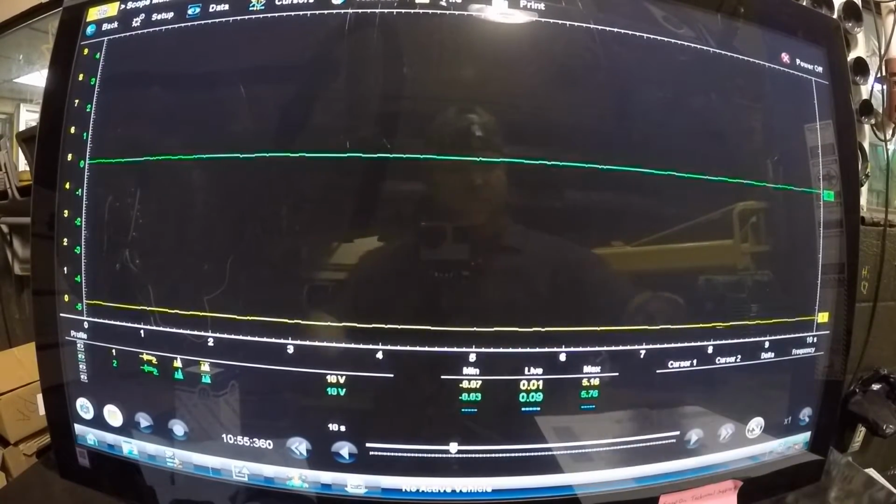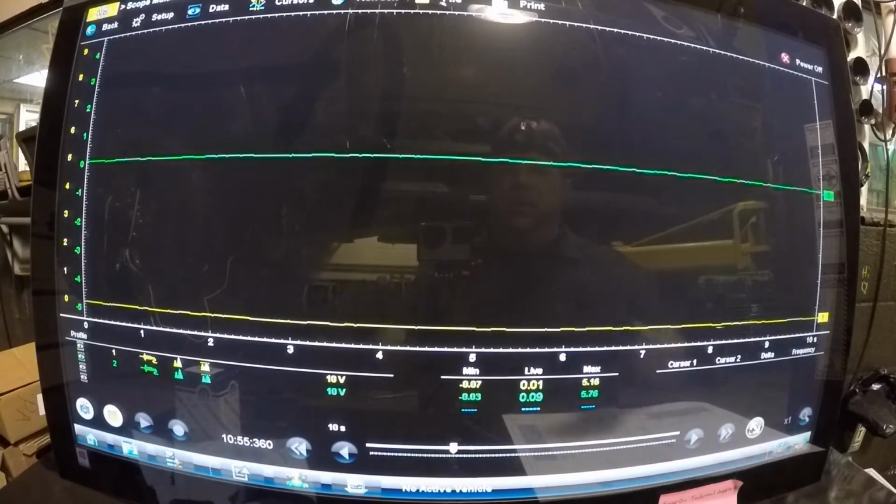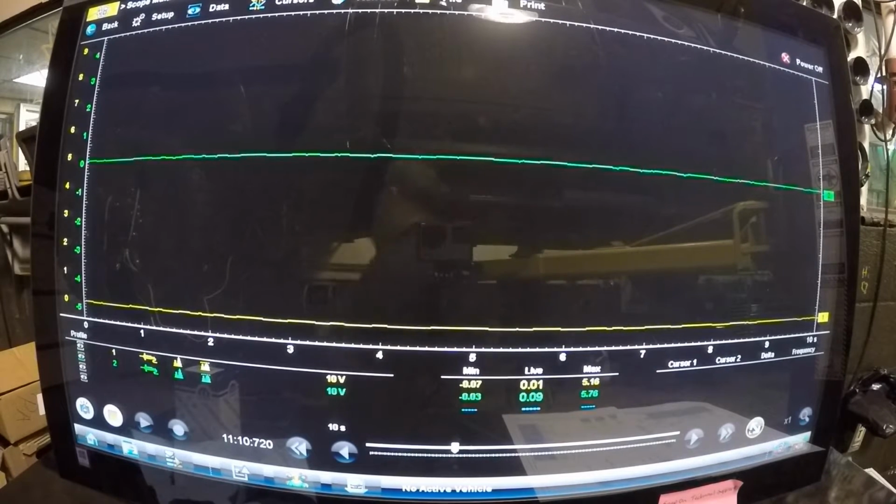We know, since we have a circuit low code, we know our ground wire is fine because the ground is actually what pulls that circuit low. So we're getting ground, so we don't even have to bother testing the ground. If we had a circuit too high code, then we would be more concerned with the ground wire. Because if the circuit's too high, we know power's good. That means we have our 5 volt. Circuit's too low, hey, guess what? That means we have ground.